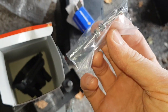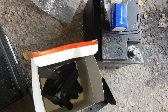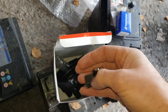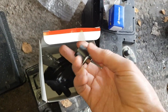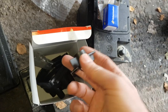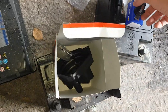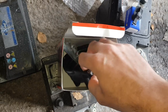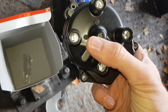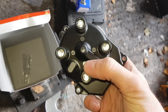They come with new bolts as well. The other thing I'm changing while I've got it off is the rotor arm. This bit basically spins around inside the distributor cap and as it goes past those little points it distributes the spark to each of them. On this one it actually tells you which cylinder it goes to — cylinder one, two, four, three.